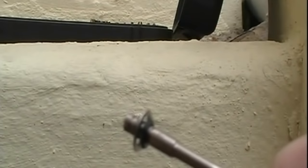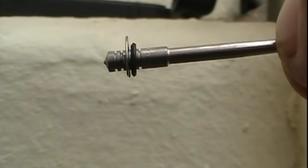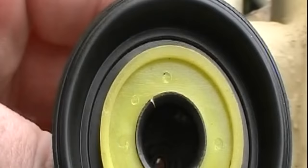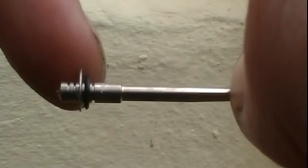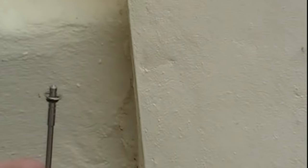This controls how much fuel-air mixture goes into your engine. What we need to do — and I'll put a diagram up to make it easier — is move the clip one position up toward the middle. It might not seem like a massive difference, but it changes how much fuel goes into your carburetor, which in turn makes the bike faster. Use a pair of pliers to move the clip. Yours might be at the bottom or top — just move it to the middle position.